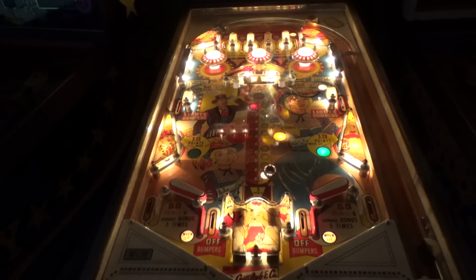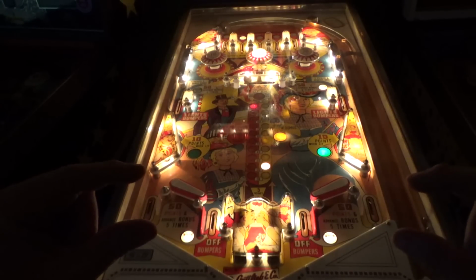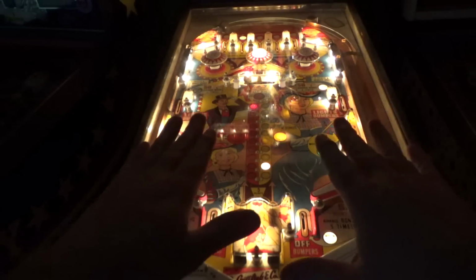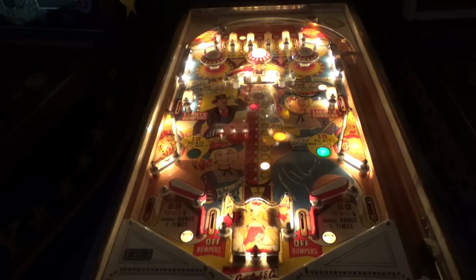We're sitting crooked because of the wheels. Look at this, it's making it miss the shot and stuff. Come on now. Come on, people. The back two, so it's on wheels with posts in them. We've got the front two right, but the back two, to give it any kind of slope at all, you have to pull them out a little bit. Well, once you pull them out, they're all over the place. It needs a good set of leg levelers on it.